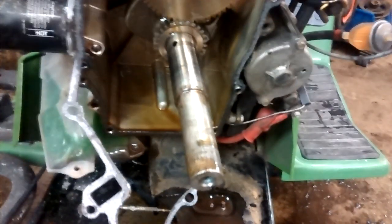There's another piece caught in the oil pickup filter, so this will all have to be cleaned out. I'm glad opening this up revealed the failure, otherwise it would have been a waste of time to take the engine off and split the case. So I'm going to order new governor parts and gaskets tomorrow and get this thing back together for the guy, and hopefully have it back to him next weekend. Thanks for watching.